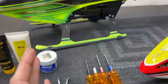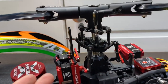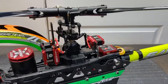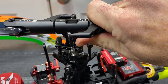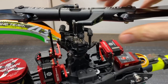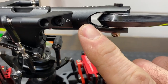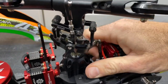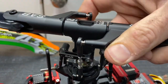Now let's clear the table and get started. First and most important thing is to visually inspect the helicopter. I have my SAB Raw 580 here — we're going to start at the top and work our way down. Grab the blades and pull them in and out, shake the blade up and down, make sure there's no excessive play, nothing looking loose, blade grip bolts are tightened all the way in nice and flush.